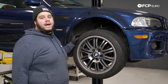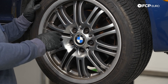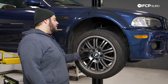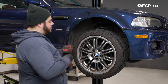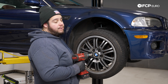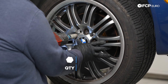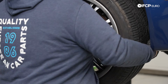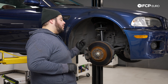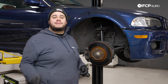To start, we're going to be working on the front passenger side wheel. We're going to get this wheel off. For those of you not using an impact, make sure you break your 17 millimeter lug bolts first with the vehicle on the ground, then raise it up. We're just going to zap these out using the Milwaukee for today. As you get to the last lug, be mindful that the wheel is going to want to fall, so brace it so it doesn't drop on you or hit the ground. Now we have our wheel off and we can show you where that sensor is on the hub side of things, and then we'll trace it back to the junction box.